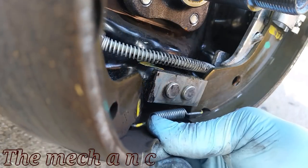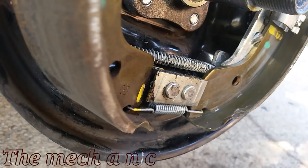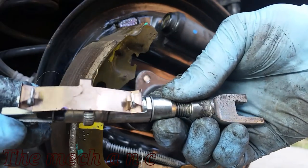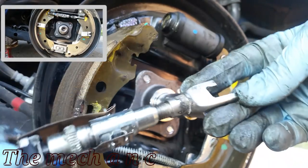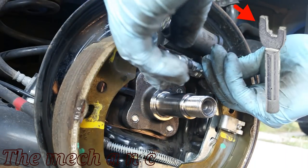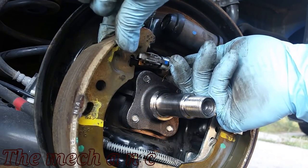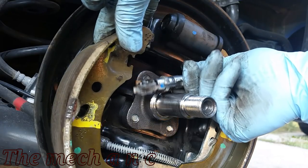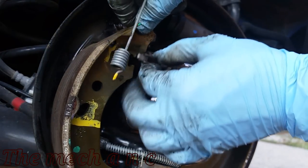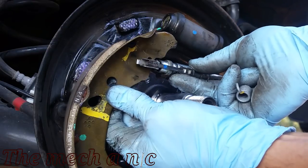It's very important that everything sits back in its original location. After putting on the lower spring, make sure this brake shoe sits behind the center bracket just like the other one. This is where that photo you took really comes in handy. On the right side of the adjustment mechanism, one end is longer than the other — the long end faces toward you and the short end goes toward the backing plate. On the left side there's a copper or bronze-looking piece of metal, and you want that piece facing toward the backing plate. Also, turn the mechanism until it's in its shortest position.